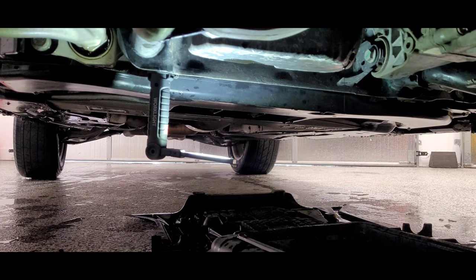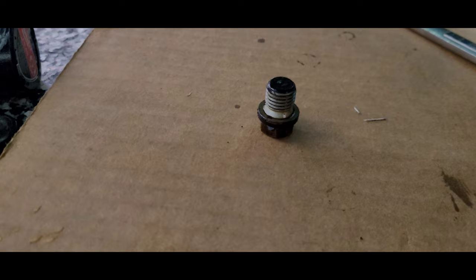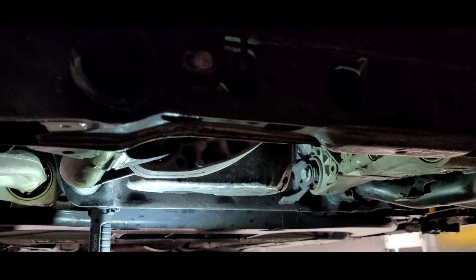You can even add some oil from up top and let it kind of flush the engine — that's not necessary but you can do it if you want. Make sure you put the plug back in with the little brass O-ring back on. Don't over-tighten it, just make sure it's hand-tight. Then go on top and put in 8.9 quarts of oil for the GLS six-cylinder twin-turbo.